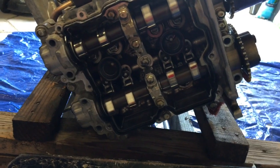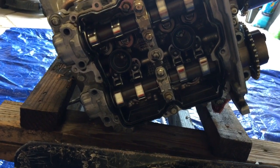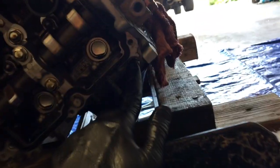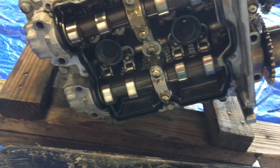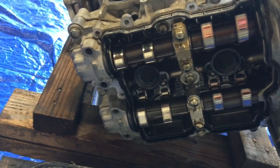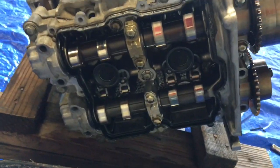I was going to remove the cams, but upon further inspection I think I can just take the whole head off with this bolt, this guy right here, and this guy — there's another one down in there. And there's another one right in the center. Instead of taking those out individually, I think I can just take the whole cylinder head out. So stay tuned.